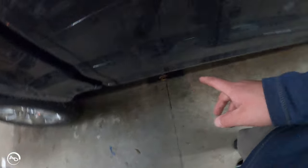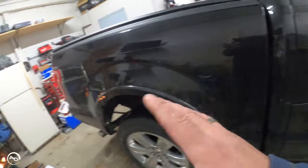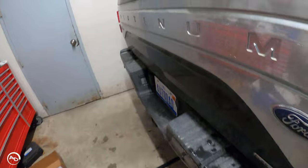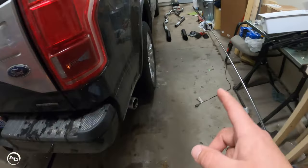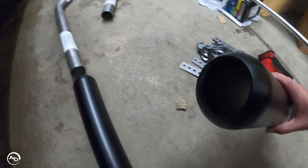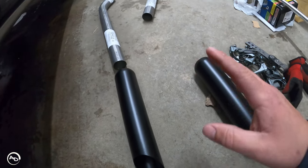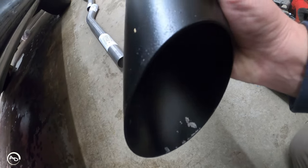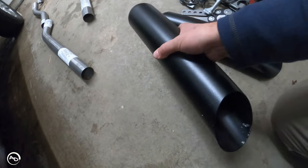There were two different listings — black tips and chrome tips. I've got the Platinum trim so I've got the chrome exterior goodies along with the applique, but I've got the black bumper, so I wanted black tips. I'm going to send them a picture about it. These weld-on tips — and they are straight-up weld-on, not clamp-on — are the same size as the pipe. Once I get it figured out I'll buff it down and weld them on, but that blemish on the inside doesn't give me high hopes for the rest of it.